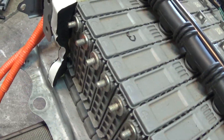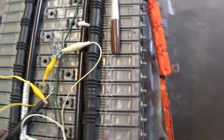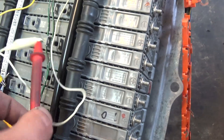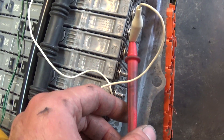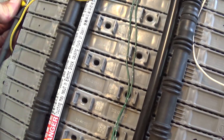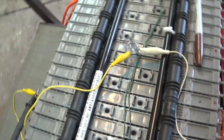I have all the bus bars unhooked on both sides. The little thing I have rigged up here is a wire going to a light bulb connected to the positive probe. What I'm doing is testing the voltage of these hybrid battery modules with a load on it, hoping that with this load it'll show any weakness in the batteries.